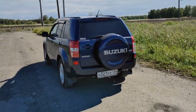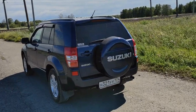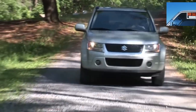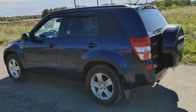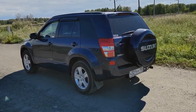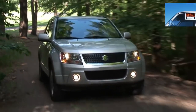From the exotic category, you can find a Vitara with a 1.9-liter diesel engine from Renault. Of the 1,500 advertisements for the sale of SGV on Avto.ru, there are only 16 diesel ones. The turbocharged engine is not very reliable, and with age, fuel equipment becomes prohibitively expensive. To save on fuel, it is better to choose a gasoline engine with an LPG system installed.